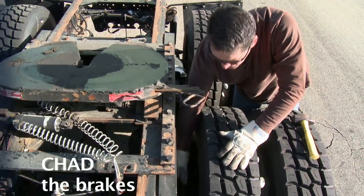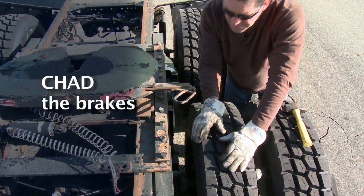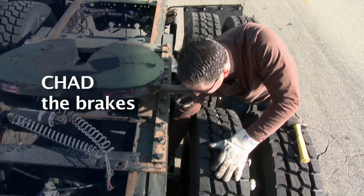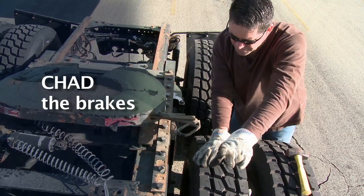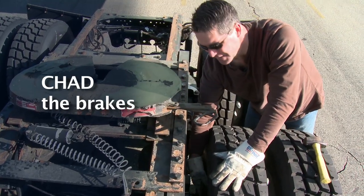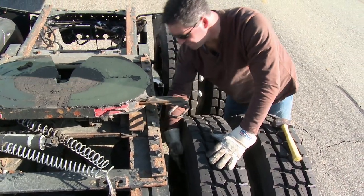Since I'm right here I'm going to go right to my brake can. We're going to CHAD the brakes. C is for the brake chamber — make sure it's properly attached, not loose or hanging. Follow the hoses — make sure they're secured and I don't see or hear any leaks. Look to my slack adjuster — it attaches to the push rod going into the brake can — make sure that's about a 90-degree angle. Look inside the rim and check my brake lining — make sure I have at least a quarter inch of brake pad. Check the inside of the tire wall for no cuts or bulges, and the rim for no cracks or welds.